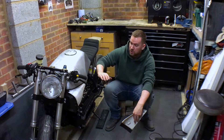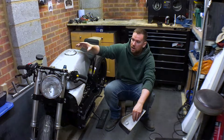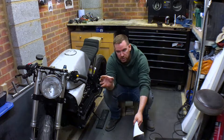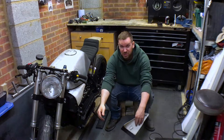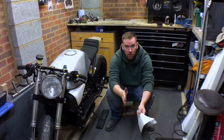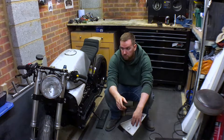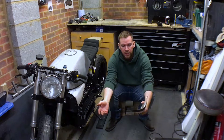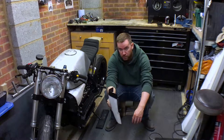So that means using the plenum chamber, the airflow meter, and a pod filter of some description on the other side. But the pod filter is going to stick out past the rest of the bike — it's going to be the furthest point over, which is going to look a bit cramped. So I'm going to try and find a way of sinking it all back in a little bit further so it's more flush. There's been a few more subscribers, so thank you guys — I do appreciate it. Still, a few of you aren't subscribing, so click the buttons down here somewhere.